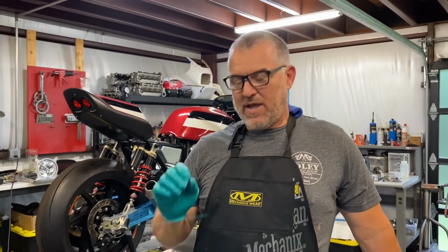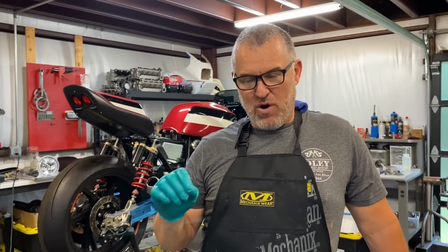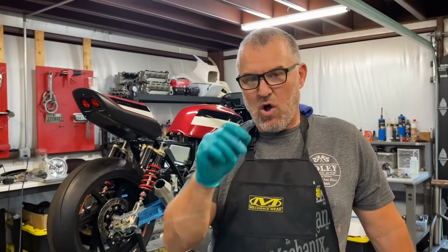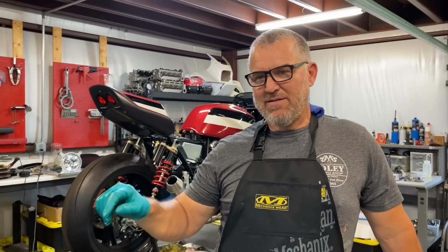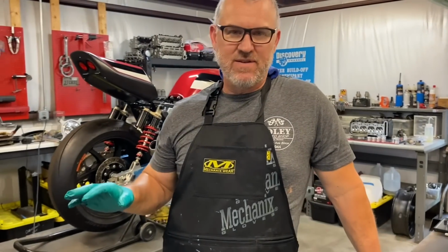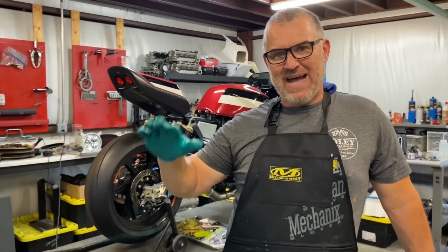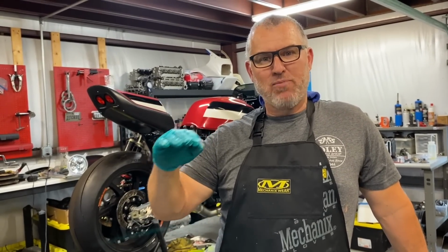This motor, and that's when we tore it apart, that's what we found. A piece of the piston had broken off, and it had broken off in a manner that it actually created a small hole between the top and the bottom side of the piston, so you were getting that oil smoke. This motor never smoked a bit, and it would be astronomical odds if it happened at the same time. On this, it was a little different. We don't believe there's a hole past the piston, but it broke parts of one of the pistons off above the top ring.